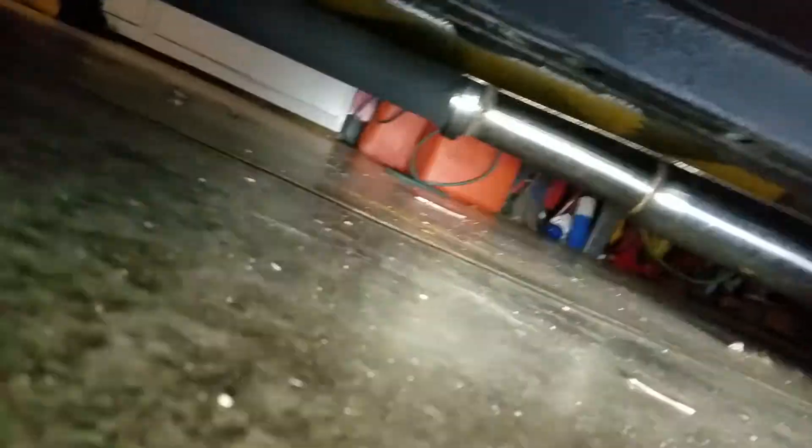There's the new exhaust hard lines — on the other side I had to redo the exhaust because it was dragging, but that was no big deal. You can see the check valves there, and the Y that goes into the single dash-eight, and then that hard line runs all the way up to the front. As you can see, the exhaust now has a lot more ground clearance than it did, so that's good.